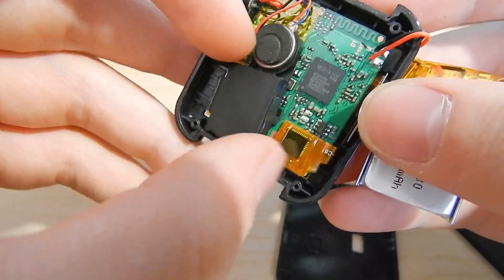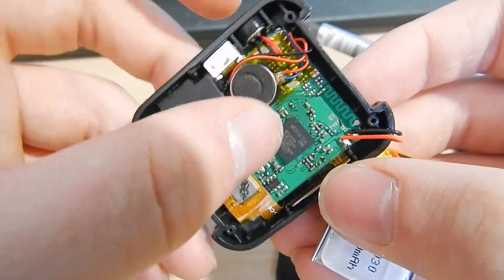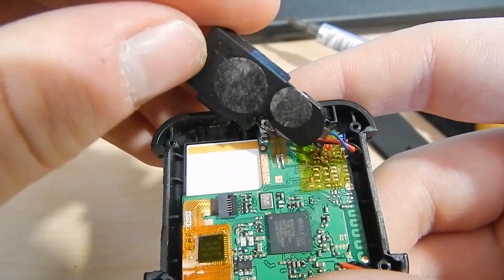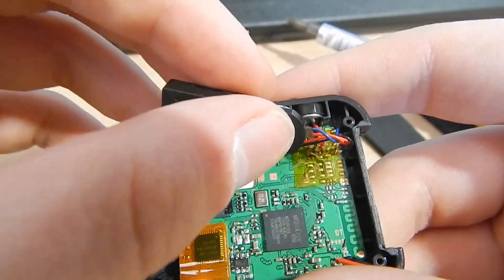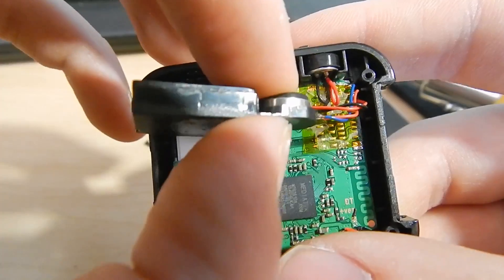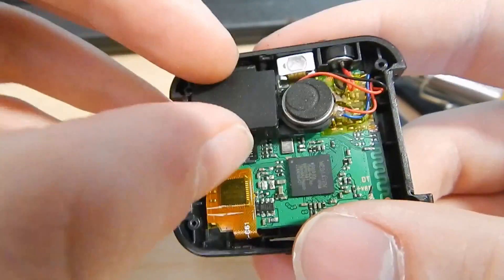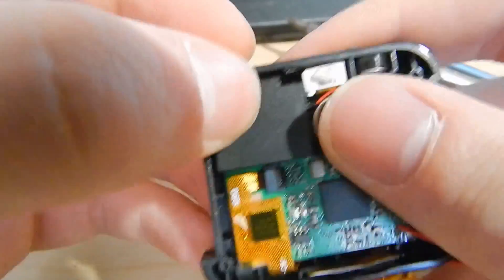That's probably why it vibrates — there's our vibration motor. There's a little microphone in a fairly decent little rubber isolation mount. This is our speaker here, and these are supposed to be glued down, they're sticky, but they haven't really stuck. Yeah, so that's probably why if I put pressure on the back of the watch it seemed to stop it from rattling — the speaker module just wasn't actually stuck down, so it was just vibrating in there horribly. At least that's easy to fix.